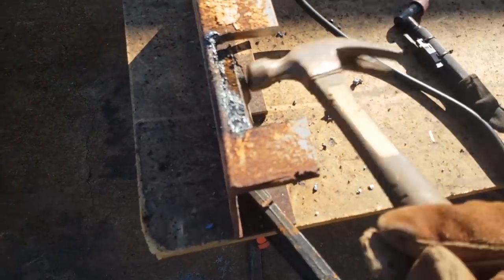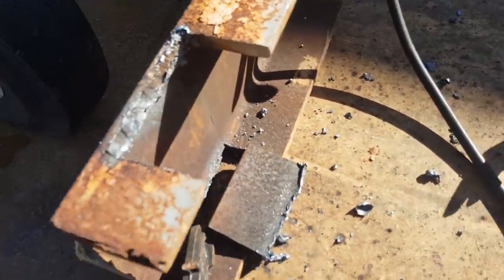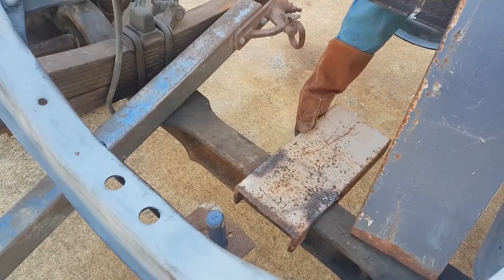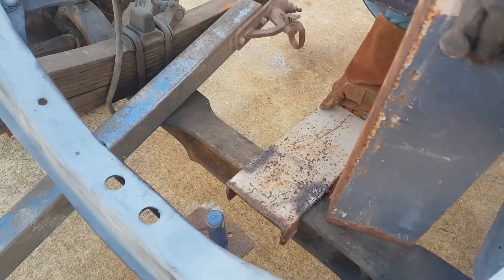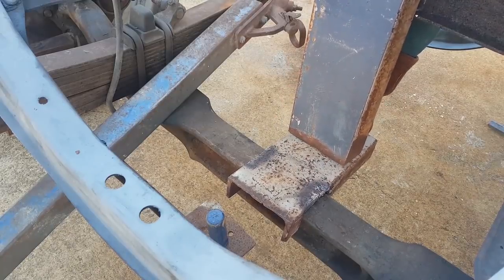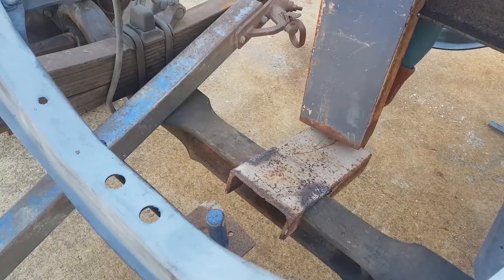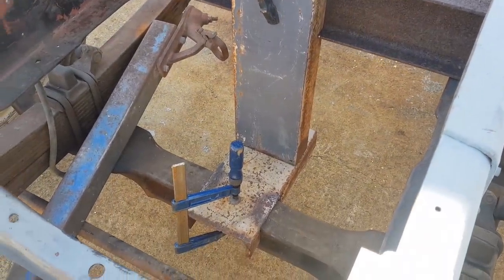Now, I don't have a particularly long way to get to the water, but I do have quite a steep driveway, and it would have twisted the chassis as we rolled it out behind a backhoe or a tow truck or the like. So by mounting this piece of steel or welding it to the chassis, it was going to restrict a lot of movement, and it did take a bit of thinking. So we came up with another idea where the bottom plate then had a smaller section that allowed independence of the suspension, and then that would carry the hook that I'd ordered previously. So that was my solution, and I'm sticking to it. And if anyone's got any other ideas, it's a bit late, but it would have been good at the time, wouldn't it?